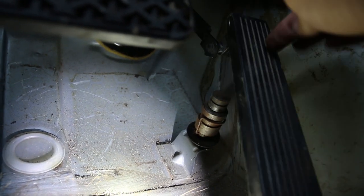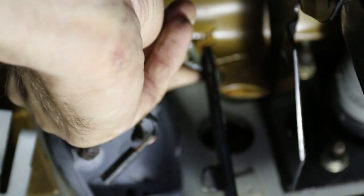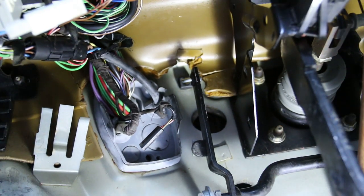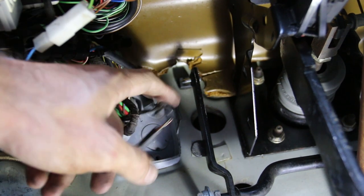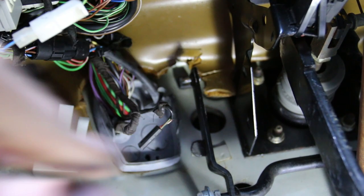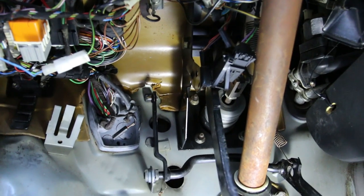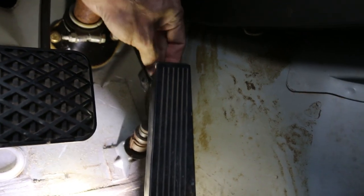I'm going to have to adjust it underneath the hood after this. Now I'm going to see if I can shove this in that new bushing - yeah, actually that's going pretty easily. This is why it popped out last time - I just had my zip tie around there. It popped out due to the fact that the motor was moving and basically just yanked this out, pressing all that weight against the firewall of the car, which is not good. Here's that last little c-clip - clip that on so we don't have any more issues.